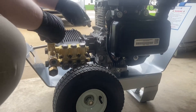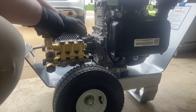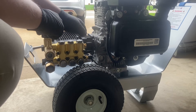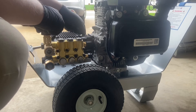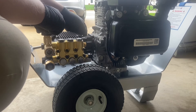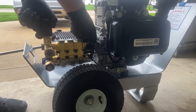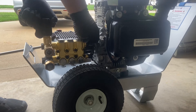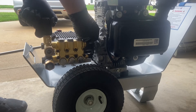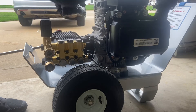I've got four bolts, and I've noticed sometimes these can be a bit long, so you kind of have to pull the pump out a bit to start them. That one's started, moving to the next. Always hand-start these — they're going into aluminum, and if you try to use a wrench first and cross-thread them, you'll damage it.